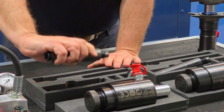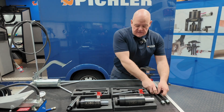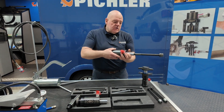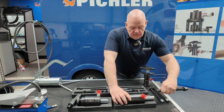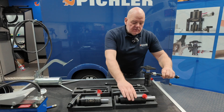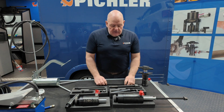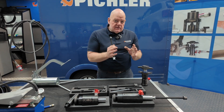You've got the drive shaft pusher, which I'll show you in a second over on the other bench. You can also upgrade the kits — we do spindle sets. The standard spindle that comes with either cylinder is a 22 into 18 mm threaded bar, which is how you'll do all your wheel bearings. You can remove this spindle and we offer a couple of sets of additional spindles — a drop-down reducer, a nut, and the spindle — which reduces the thread size. That gives you the option to use bush kits or cup and plate kits you've already got from different manufacturers with threaded bars and nuts, converting those to hydraulics.